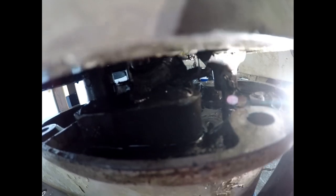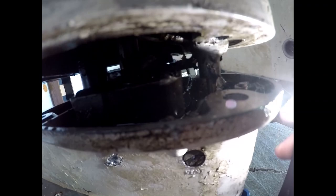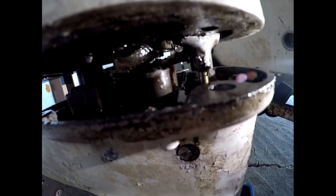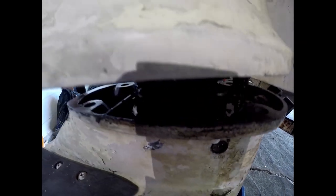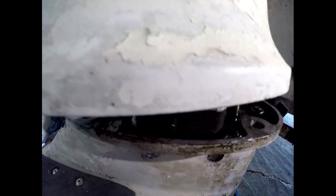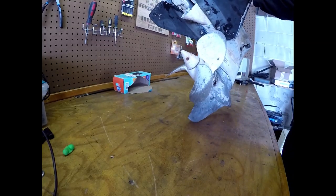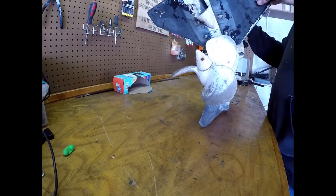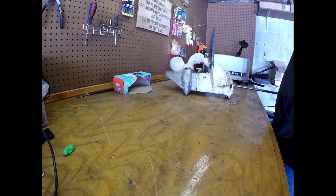If you can see here, there is a little itty-bitty pin — right there. That's where the needle nose pliers is going to come into play. We're going to remove that and this whole unit is going to slide out. That's all that's holding it. There's the linkage, and as soon as I pull that little pin out, this whole bad boy is coming out. Now we've got that off. I am pouring fuel out everywhere — that's okay, this is during the drain.